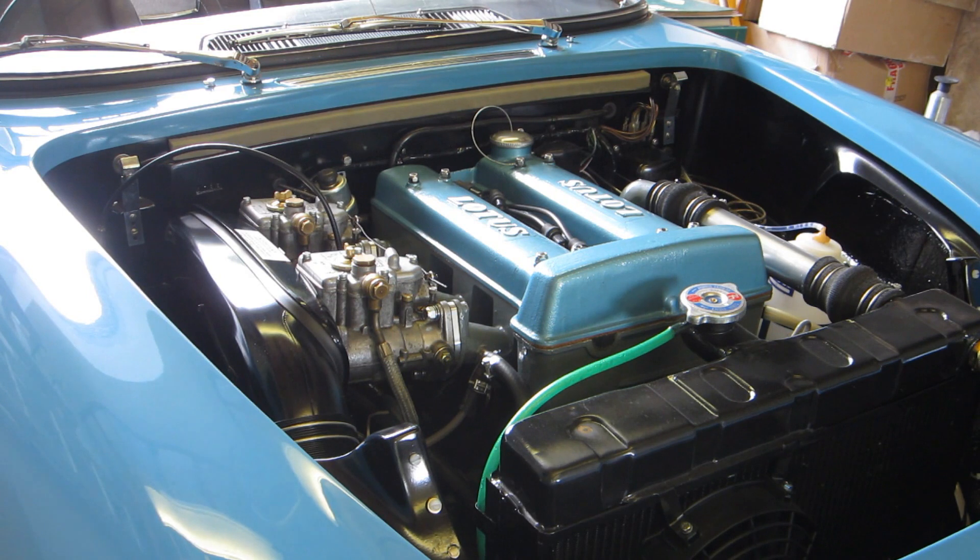I've made a few changes since it was first on the road. I've sorted the accelerator cable because when the bonnet was closed it was tending to interfere, and I've also changed components in the distributor.